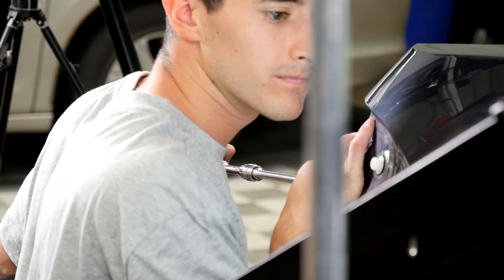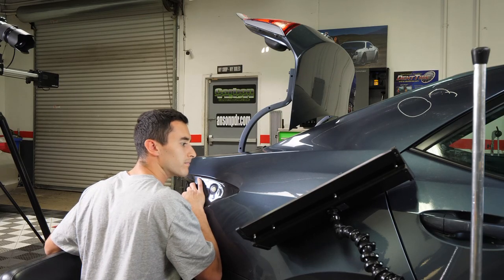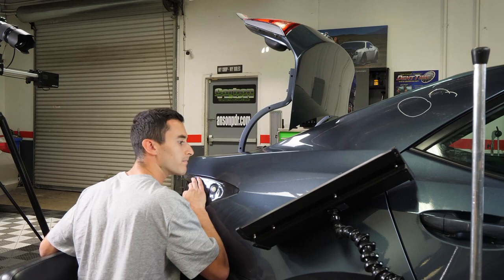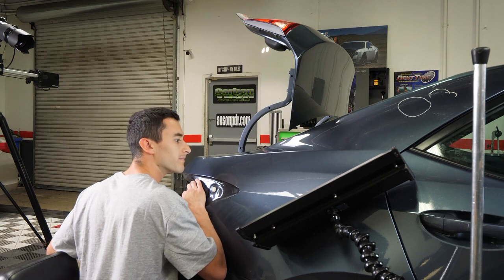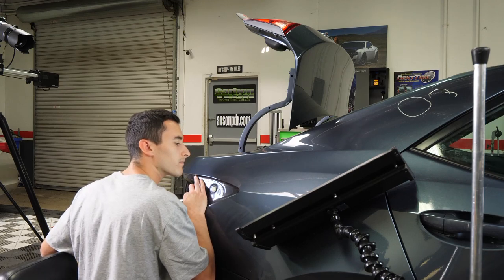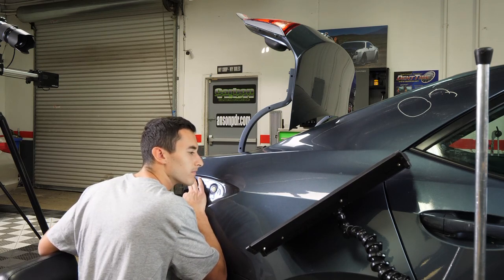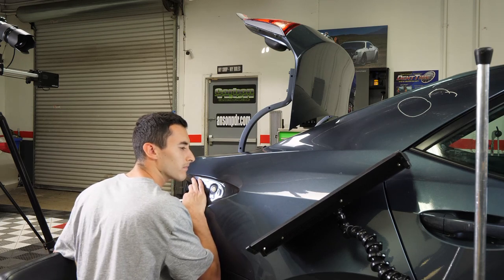He's got a perspective here — see how he's got his head closer to the panel. The way you get a clean dent is: dirty face, clean dent. When your face is off or not near the panel, your face is clean technically, but your dent is dirty — it's not clean. That's what I'm referring to. You can see he's getting better and better, cleaner.